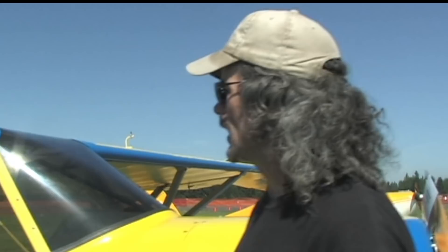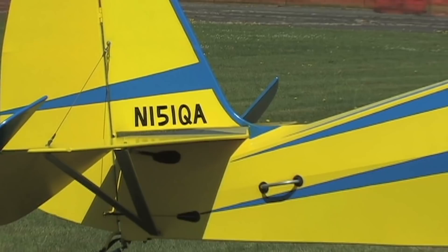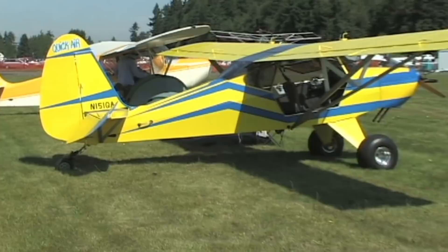You also put a lot of airflow fairings on everything. Cleanliness-wise, I used the good old Avon Magnums for fairing. The lift struts are all faired too — a friend of mine, Eric, who's really good with wood, helped me. We took 2x4 clear number-one cedar, sawed it to a tapered shape, and covered it in fabric so it gives an aluminum look. I also did the jury strut and went with tube lifting struts back at the stabilizer, fairing them in as well.